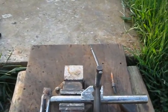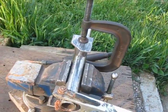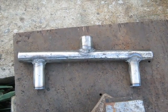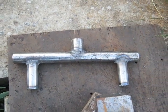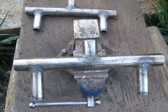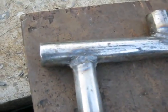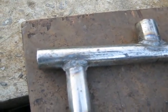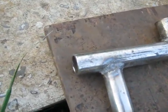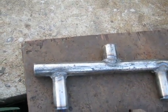They all fit together okay. It takes a long time to do all these little bits and pieces. Here we have the welded-up intake manifolds. Still have to flap-disc them to get the weld spatter off and clean them up. Also got to cut pipes to length and different things like that, then the next fitting goes on the end there. At least they're welded up now.